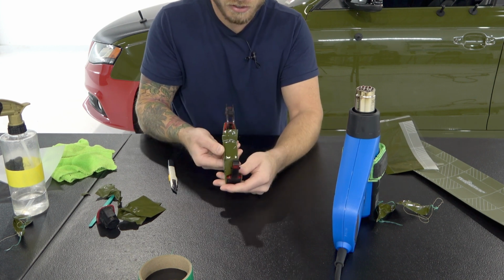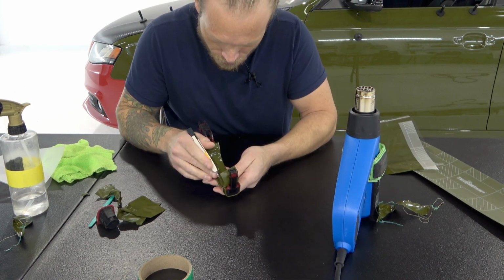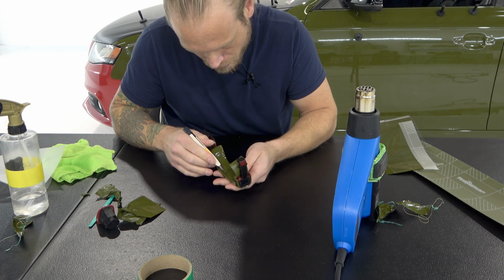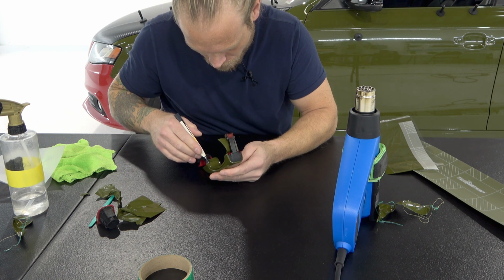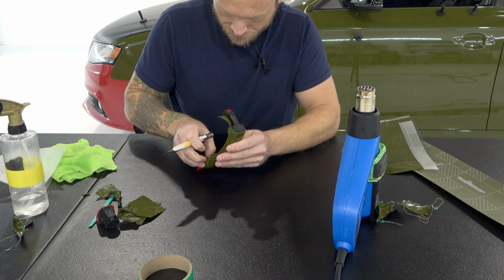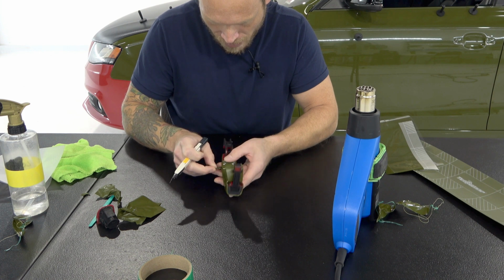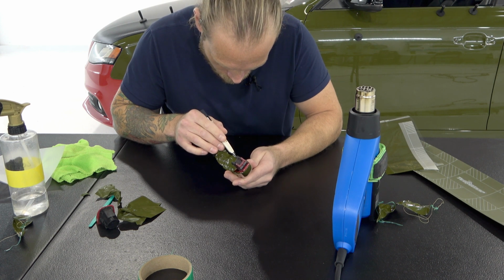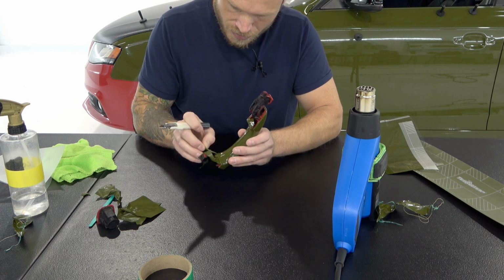Now I have some trimming to do, okay? This is not finished yet. So let's trim. This is where I said you could have put knifeless tape, or cutting tape, or you can freehand cut it like I am right now. The object here is to cut and score the film without actually cutting through the film. So I shouldn't even be technically grazing or scratching that underside layer over the main piece underneath. Come on, right here. And again, as long as you have no wrinkles, no one's going to feel the seam that's in this area. Good.